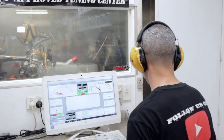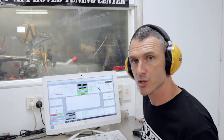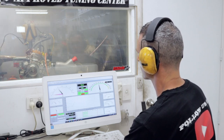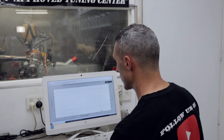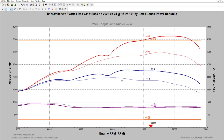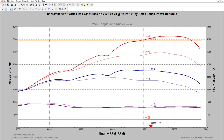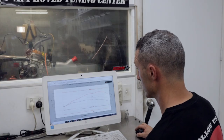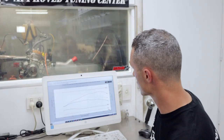Sounds a bit better! Now that the engine is all warmed up with water at 50 degrees, it's time for a comparative test. Looking at the big spring versus the little spring, you can see the difference it's made. Just changing that one spring has made all the difference — everything above that solid blue line. With the blade not opening, the engine was trying to breathe only through the two little auxiliary ports and there wasn't enough exhaust timing. Now with the power valve operating perfectly, we've got huge power gains. Make sure you change that spring over, because that is a bit of a rookie mistake.